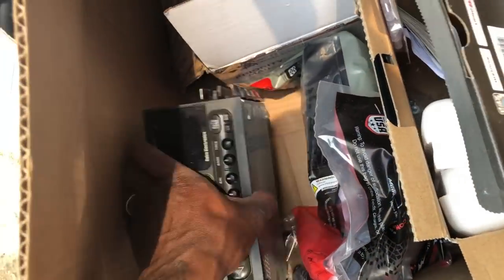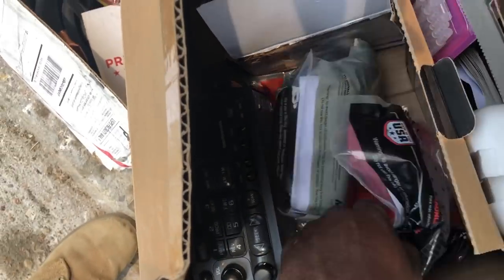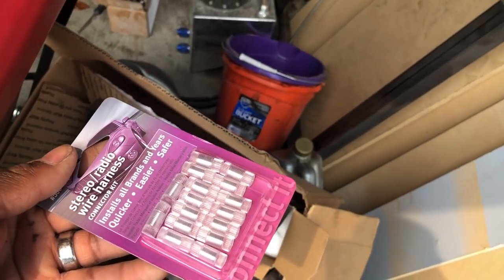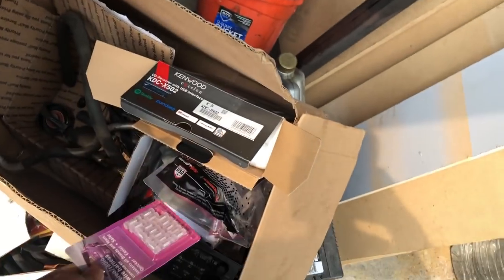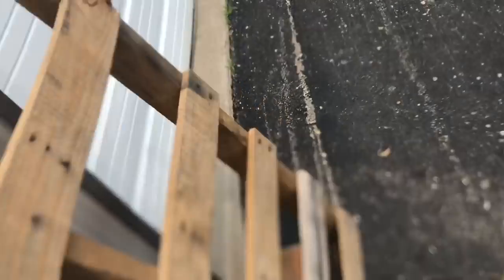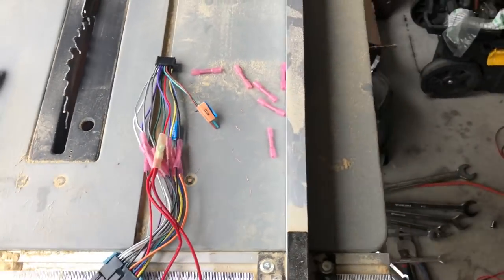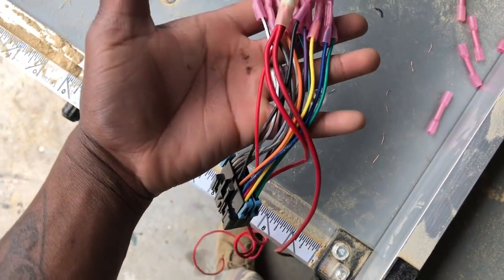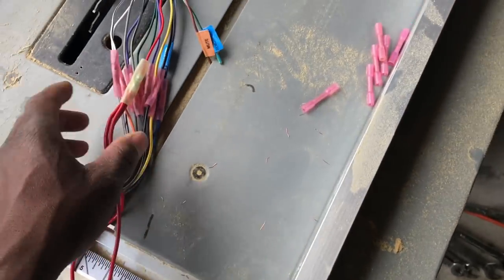Critchfield sent this — basically tightening up on the wire, an electrical type connection. I don't like using those though, man — them boys be falling off in the back. Something bounces around, you hear spark, fuse blown, all kinds of stuff. So I like using these. Once you crimp, get your heat gun and shrink them boys up.